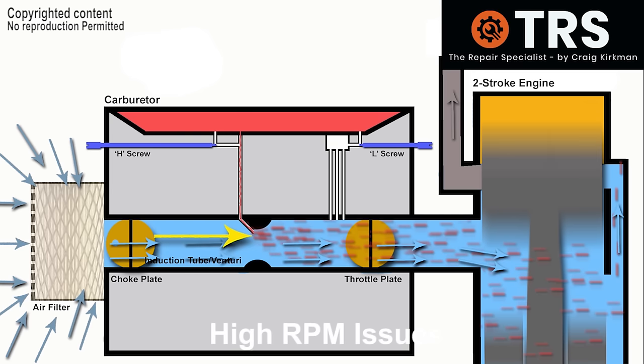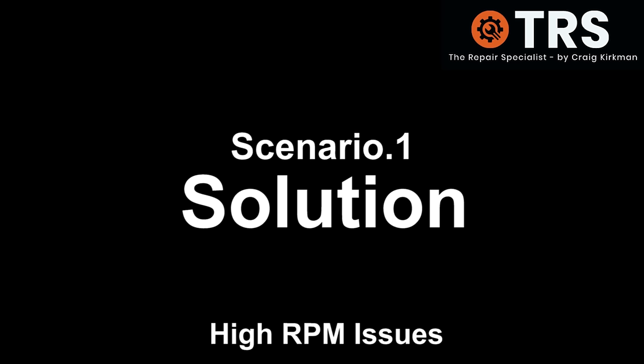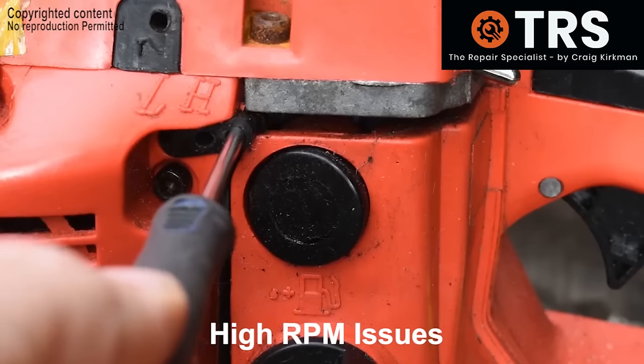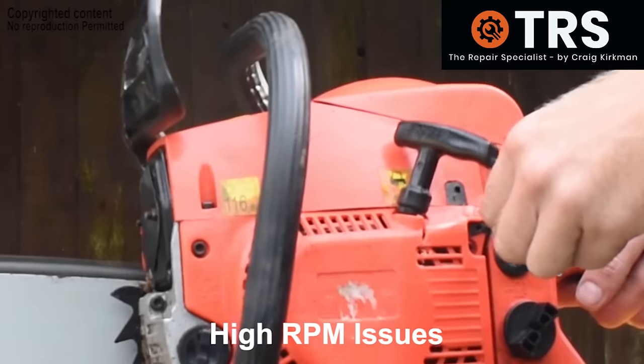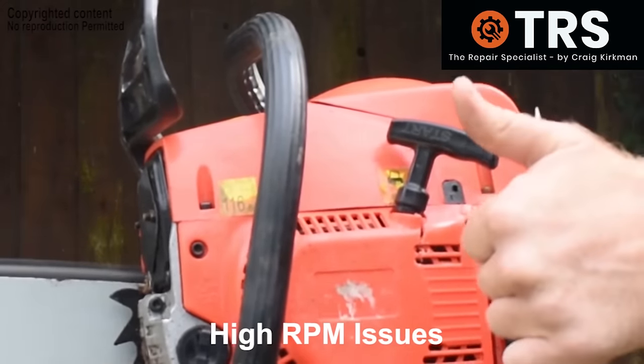We need the air to draw out the fuel, but if the fuel is restricted in some way, then the fuel is going to prevent the engine from running at maximum, and therefore prevent maximum intake of air. In a nutshell, whether the throttle plate is either open or closed, there's only the same amount of fuel going into the engine — sufficient for idling only. If we want to correct this, it's worth trying to adjust the H screw outwards anti-clockwise slowly until the problem subsides, and in this instance it's sorted.